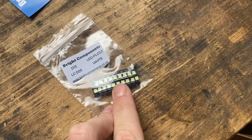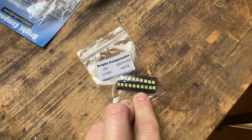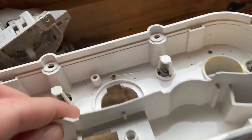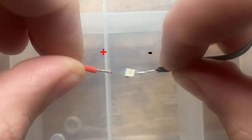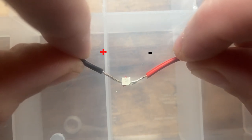The LEDs on the back of the panel are a twist fit, so they're nice and easy to replace. I'll leave a link in the description to the specific LEDs and an eBay shop where you can get whatever color you want. One important thing to note is that LEDs have a polarity. On this specific LED, a little notch cut out of the bottom right corner indicates the negative side - negative goes to that side, positive to the other. If you switch those around, the LED won't light up.